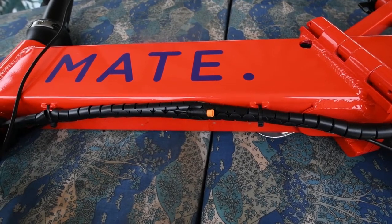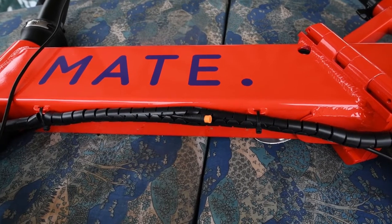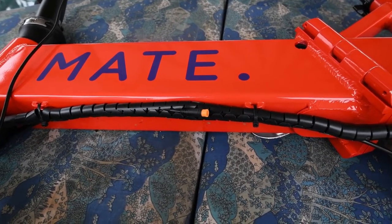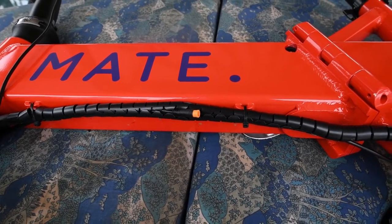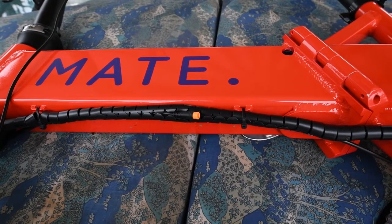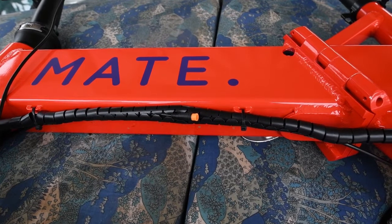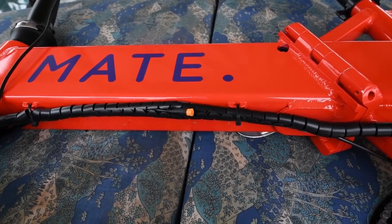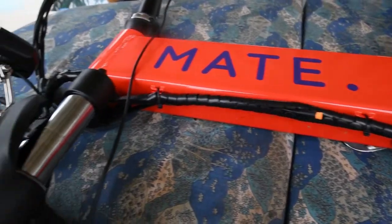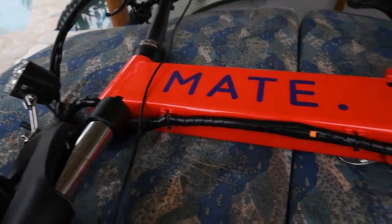This right here you're going to find is the connector for the front lamp. It's wrapped back in this wiring harness, and all you need to do is take off the tie wraps and the plastic wraps on the cables and get that out so that you can use that for the front lamp. You're going to want to pull off all this wrap